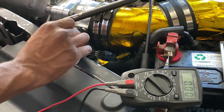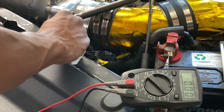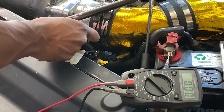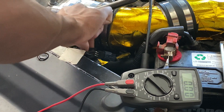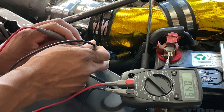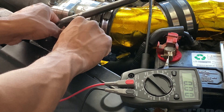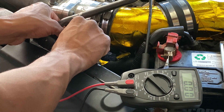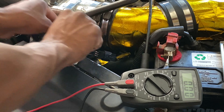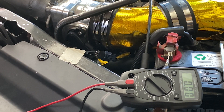You can see I'm off quite a ways, so I'm going to rotate the TPS — rotating up should do the trick. There we go, it's 0.48. I recommend going ahead and tightening the screws maybe a half turn to a full turn, and then go back and verify that tightening did not adjust your TPS setting. Having it at 0.49 is fine — it's recommended to start at 0.48 and then make increments to 0.49 if need be, and then 0.5.